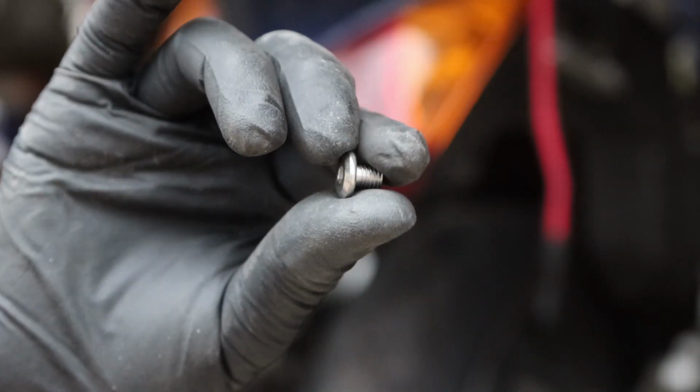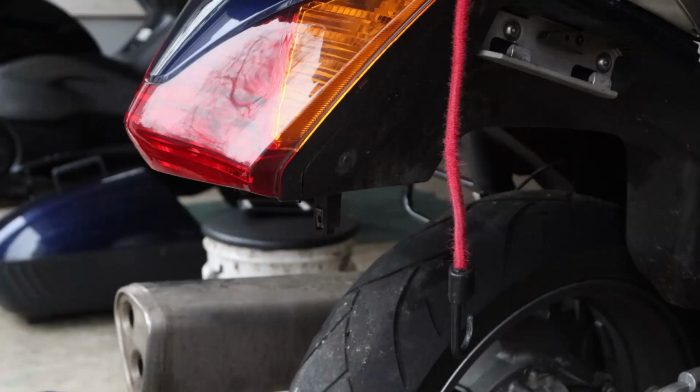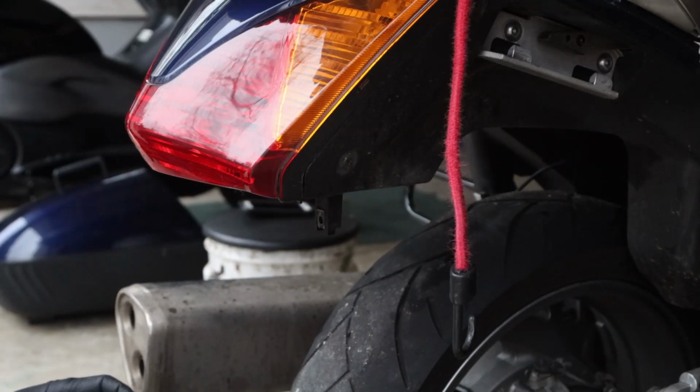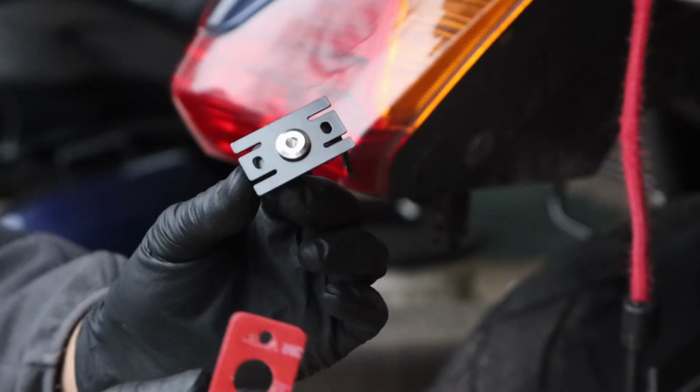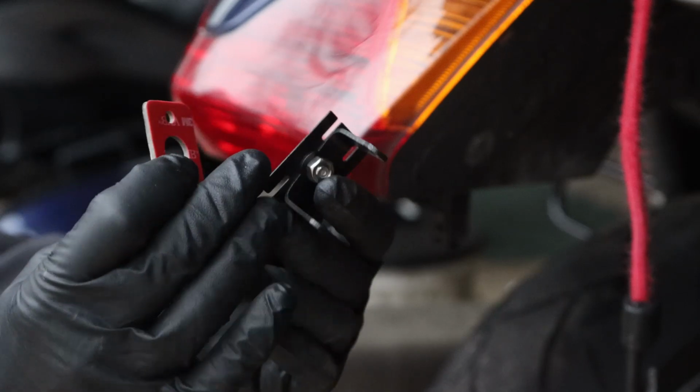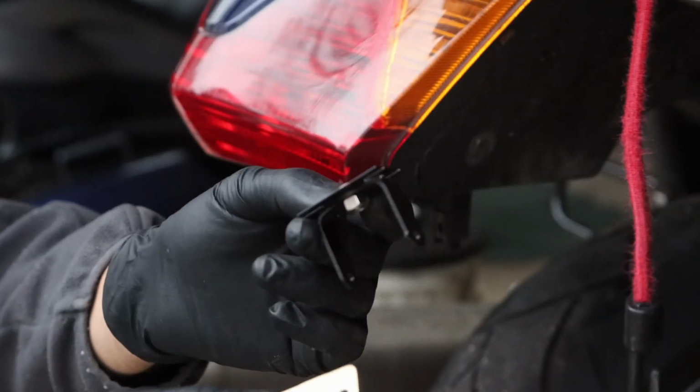It's kind of flat. Seems to be the best way for my particular bike. Here you clean everything really well, the adapter and the 3M tape. So when you tighten this, make sure you tighten the bolt here, because once we put the adapter on, it's not going to be easy to install or to tighten.